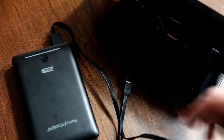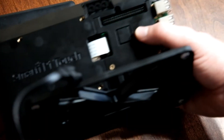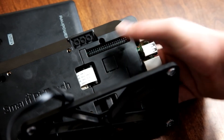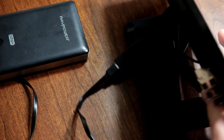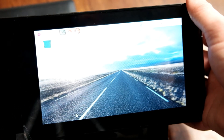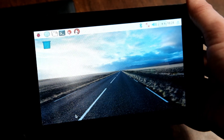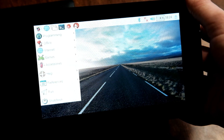So I went ahead and connected the power supply here — I'm using the 2.4 amp. If I use the 2.1 amp, it doesn't have enough power to power both the Raspberry Pi 3. I went ahead and connected the ribbon for the video out, and I snapped in the back piece. You can see here that now I have an operating system running on my machine. The touch screen, everything works by default using Raspbian. Pretty cool.